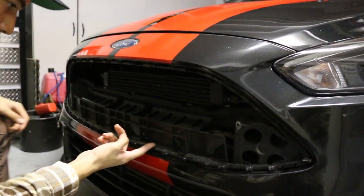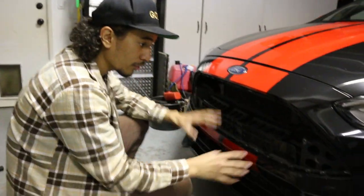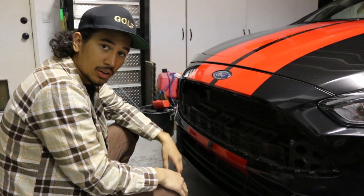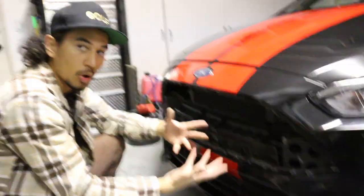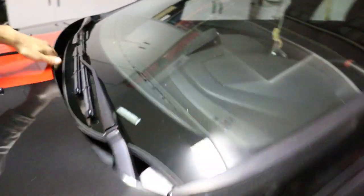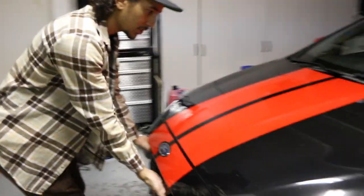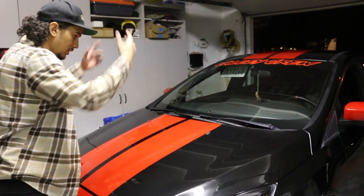I'm going to remove this entire section right here because eventually I'm going to have a tubular front crash bar or bash bar, which will allow for even more airflow and get rid of the factory bash bar that blocks a lot of airflow to the radiator. My intercooler comes up to about right here, so it'll open up some airflow to that as well. I also managed to remove the cowl, which allows more air to flow through the entire engine bay. I also removed the sound deadening from the bottom of the hood to open everything up.